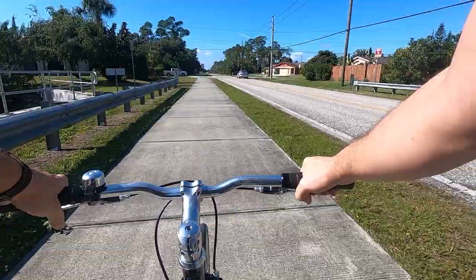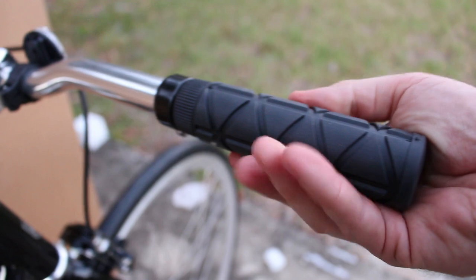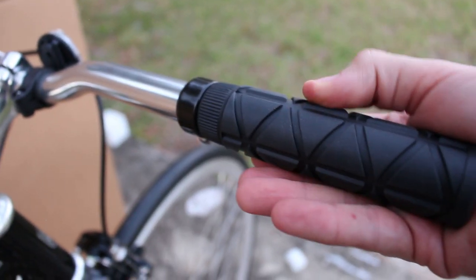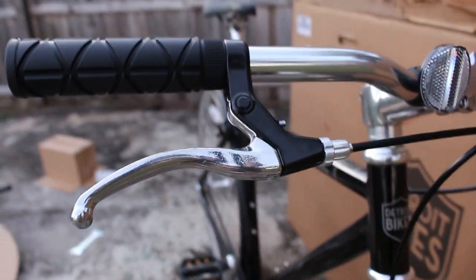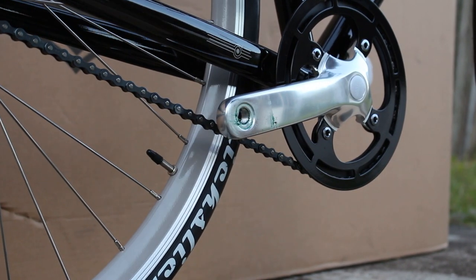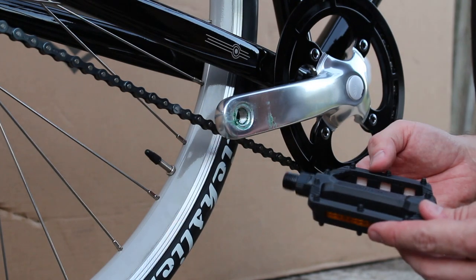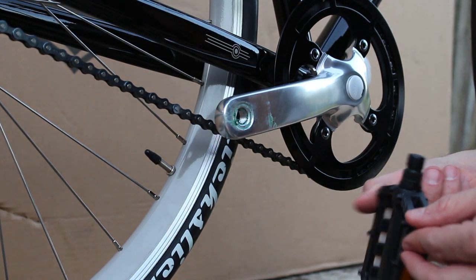Bars are 630mm wide with just black Kraton rubber grips. The brake levers don't seem to have any name at all but they are all aluminum. The calipers also have no name and they are center bolt side pull style. The wheels are aluminum double wall 32-hole Star Circle brand, 30mm deep. I don't know the width but the braking surface is machined.